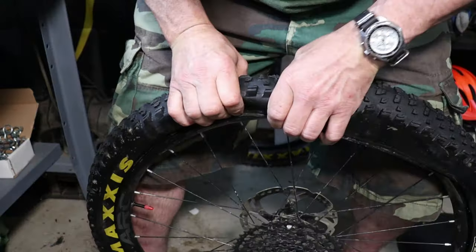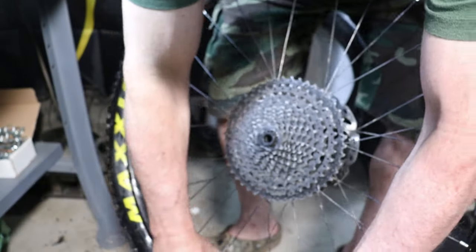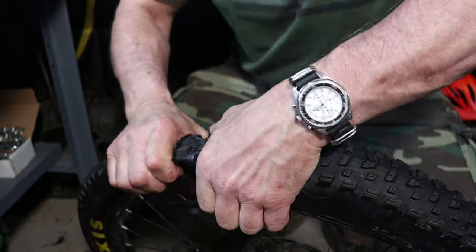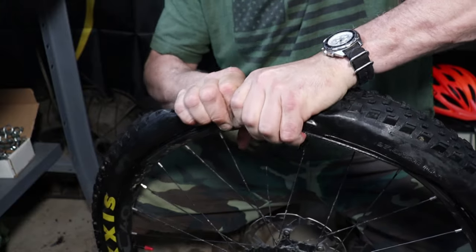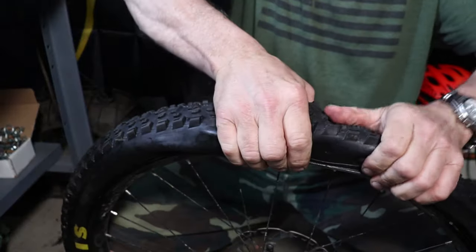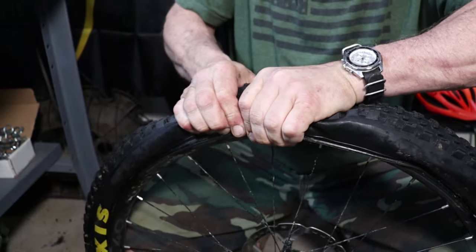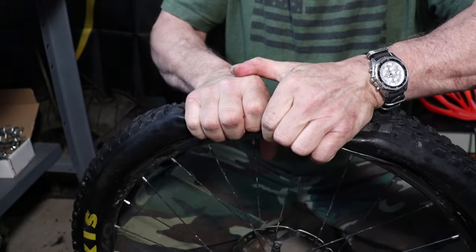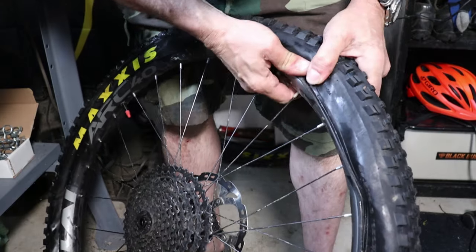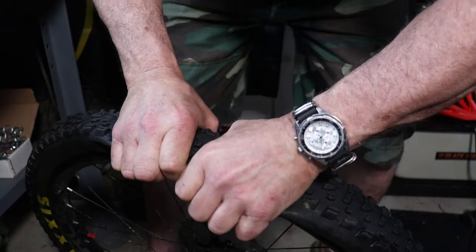You really gotta pull to get this baby on. Keep wrestling from the opposite side, bring the gap up, get as much of the bead in as you can, squeezing both the bead and the insert to get it into the deepest part of the opposite side of the wheel, commonly known as the well. You gotta promise yourself you're not gonna use tools on a tubeless unless all else fails — this is what gives you slack to pull the remaining part of the bead on. It's definitely a struggle, but we got her.